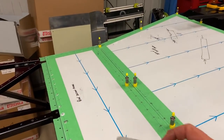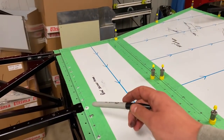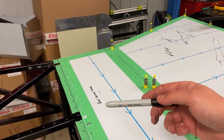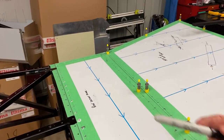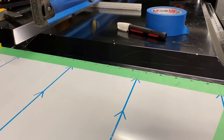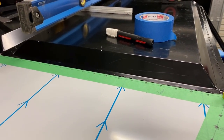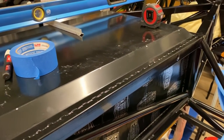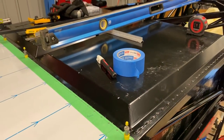Up here at the front, in the centre section, I'll be replacing a couple of these rivets with some rivnuts and I'll install just a skid plate there that will double as a central jacking point. On the leading edge of the floor pan there, which you can see is quite exposed, I'll also be putting in some protection and run something down the side of the floor there, just so if you do get hung up between the wheels, you're not going to be sitting on the chassis or the floor and wearing that away.